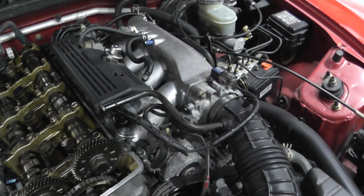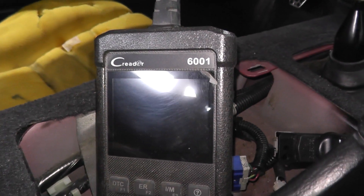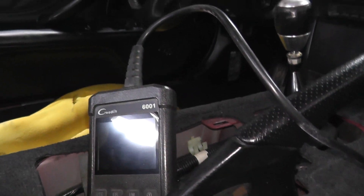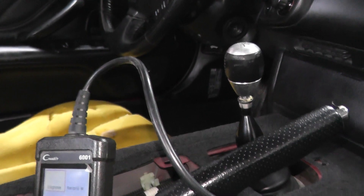I'm going to show this through two different techniques: one is without a scan tool and the other is with a scan tool. This is a very inexpensive scan tool — it goes for $40 on Amazon and I'll include a link in the description box below. It's terrific for doing just very basic things. Specifically, we need to do something called data stream — we need to see the data stream from the vehicle's computer. For 2000 and 2001 S2000s, that data link is on the passenger side; I believe 2002 was the first year it switched over to the driver's side. So make sure you find this port — it's called the OBD2 port.